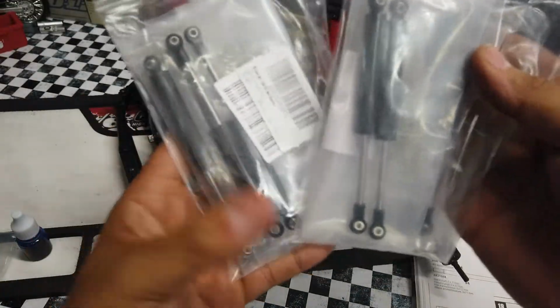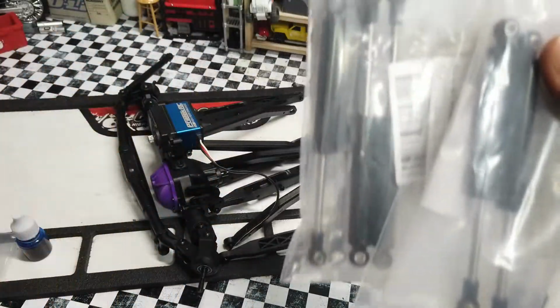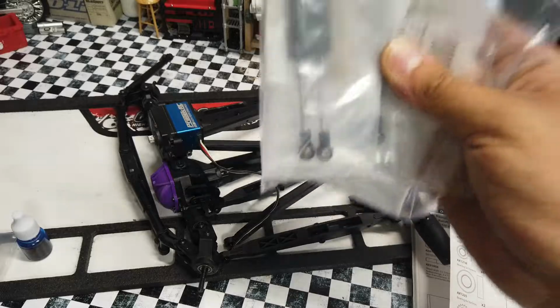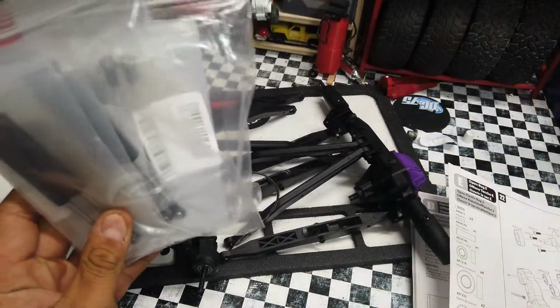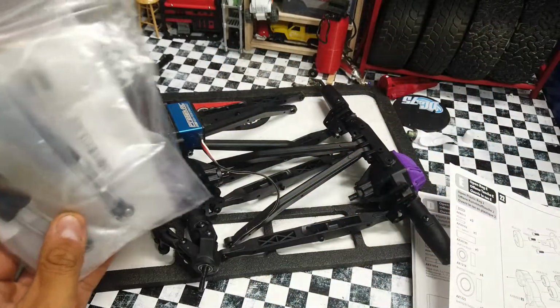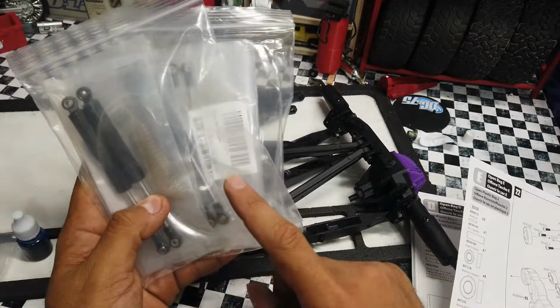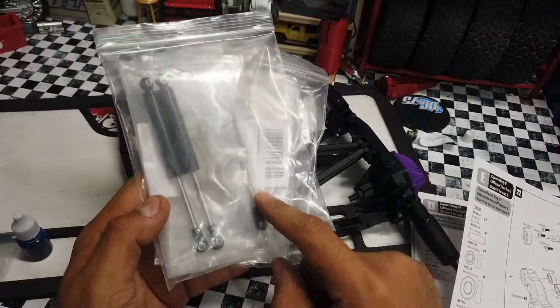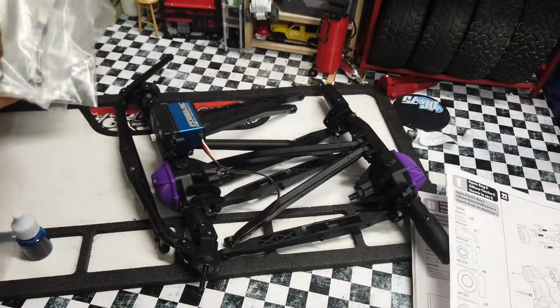Again, link will be in the description for these. These are internal spring shocks, so we'll see how they work. This is going to be pretty interesting mounting these. Although this is the next step, I'm probably going to save this towards the end, because my mind needs to see how exactly they're going to fit onto the tube chassis itself, where they're going to mount. And these are shorter than the stock ones. The stock ones are 120 millimeter. These are 110. I wanted it to sit a little bit lower to get some better handling.